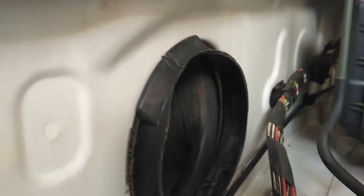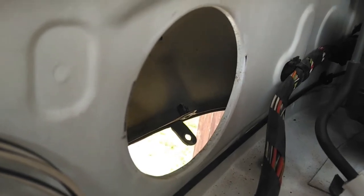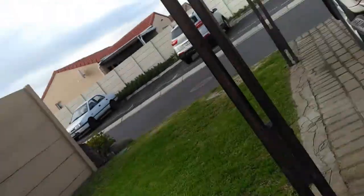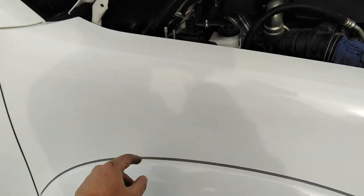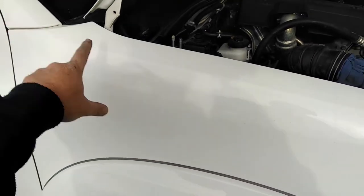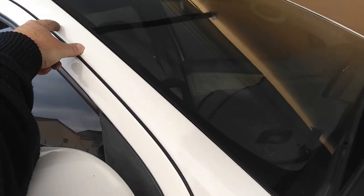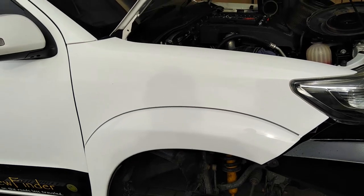There's this little pipiki sticking out here — this will just clip out or turn and clip out. There we go. So that's where the air intake will be through. Check it from the bottom — the S-bend will attach to there. Come to this side over here, and there will be a hole made somewhere around there. So first up what we're going to do is attach the template so we can mark our holes to drill. Also, after we've done that, we're going to attach the bottom part of the snorkel so we can get our alignment for the top where the mounting bracket comes in for the intake. Let's prepare the template so that we can attach it.